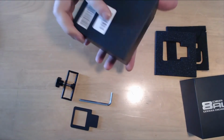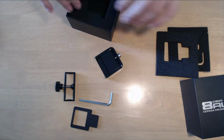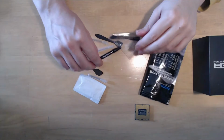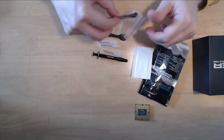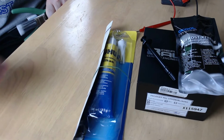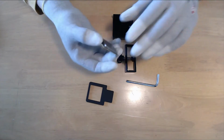First, we need to separate the die from the IHS. To do so, we need a tool called a delid toolkit. Thus, we call the whole task the delid process. You also have to buy the liquid metal thermal material that is going to be applied upon the die and a high temperature silicone sealant to seal the chipset with the IHS. Having all this makes the rest of the job considerably easier.